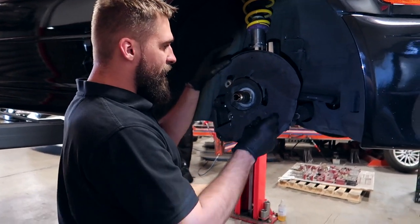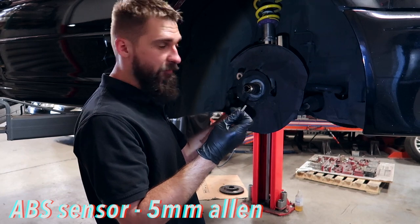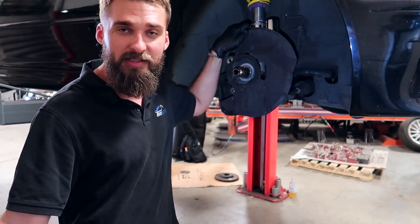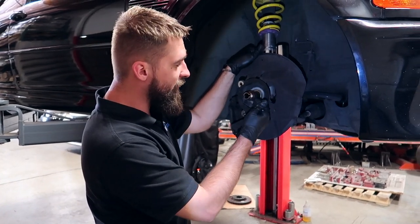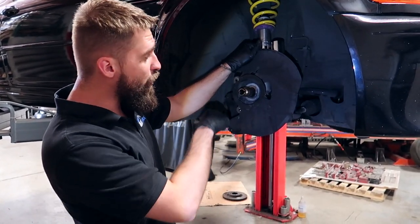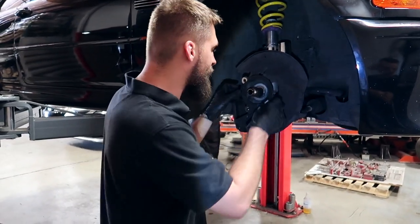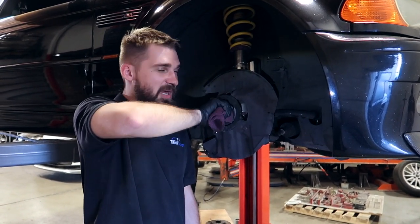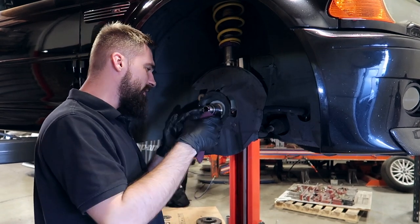What you saw in the b-roll: we had to remove the dust shield — there are three 10mm bolts and then in the back there's an ABS sensor on a 5mm Allen. Remove the sensor, remove the shield. We had to do this because the race was stuck. The race is the back portion that covers the bearing. It got stuck so we had to cut through it. Make sure to be real careful with the spindle — don't cut the spindle, don't damage it. Heat it up, cut it, and get that thing removed. Now we wait for it to cool off.